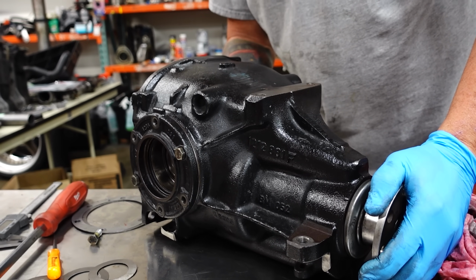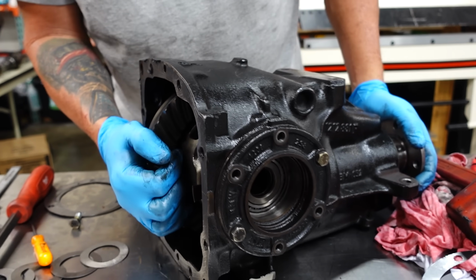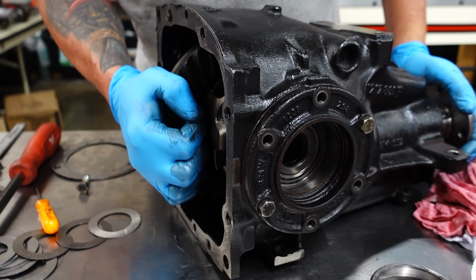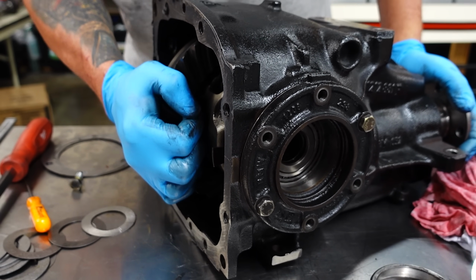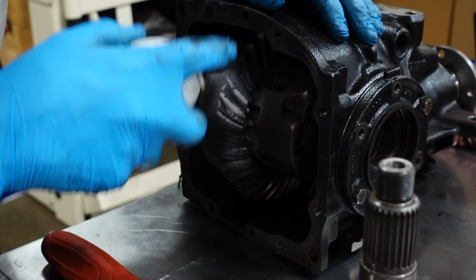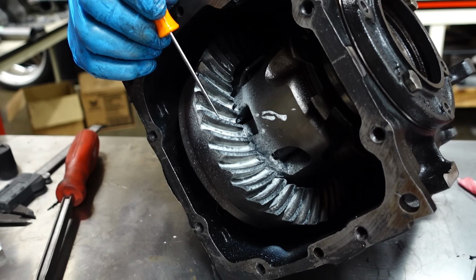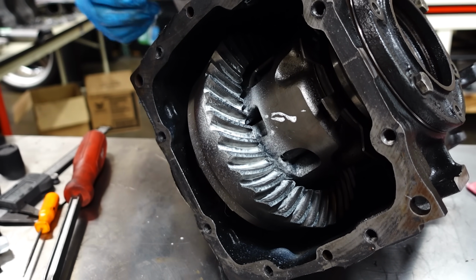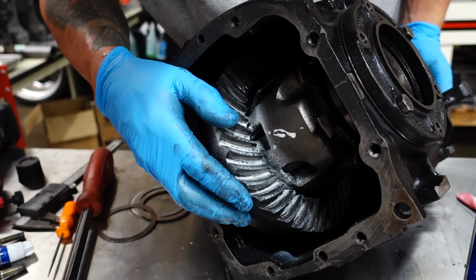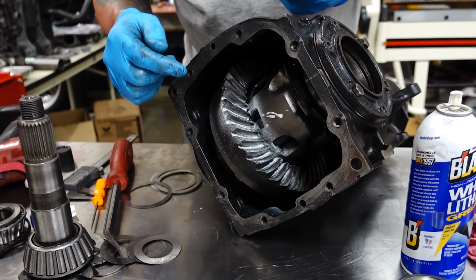So it needs adjustment. It's close. I mean, I'm doing it by feel, and I'd say it's probably 5 thousandths. 6 to 7 thousandths. So that's close. Yeah, you just want to get it more in. So this actually may need to, but it won't actually go, because you're pretty tight right now. Yeah, that's what I was thinking too. It still has to basically go out.